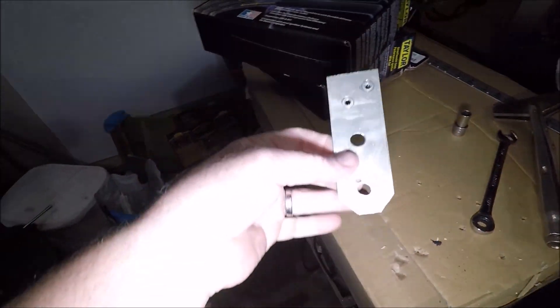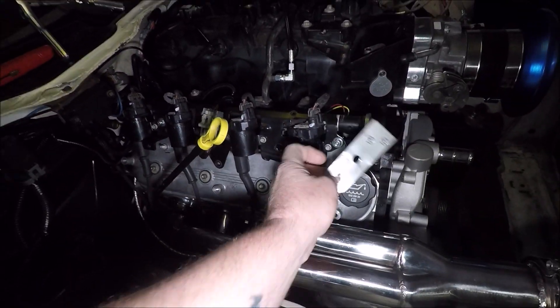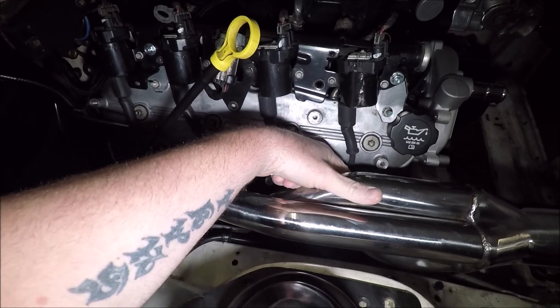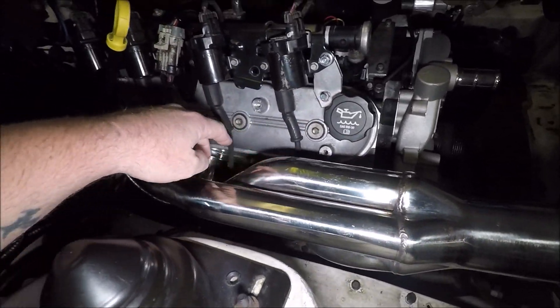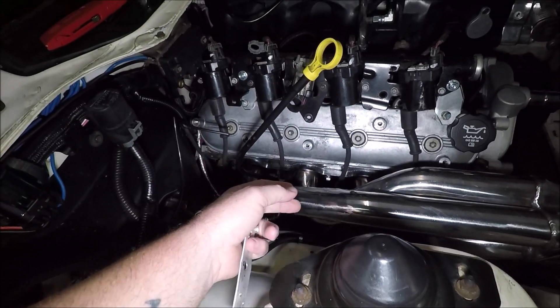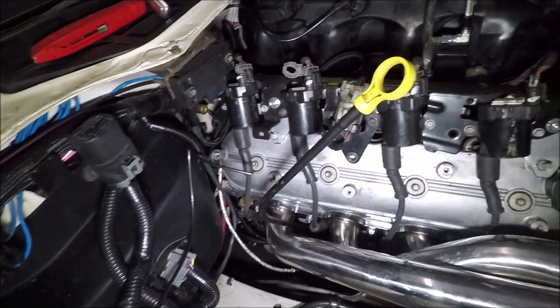The way I made these brackets: I just took some scrap metal I had laying around, drilled a hole in it, and mounted it to the two bolts I wanted to use to mount my coils. Then I plugged the wires in and held the coil up until the boots were taut enough that they would clear the headers and not be touching anymore, but still had just enough play so they wouldn't have a lot of tension and be popping off the coils. That's your solution right there.